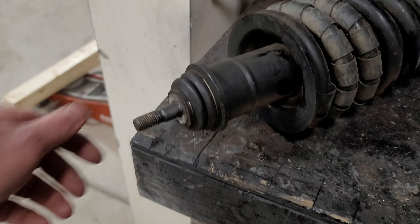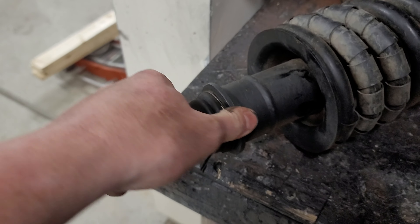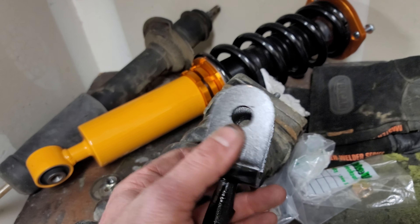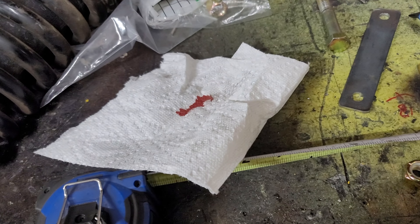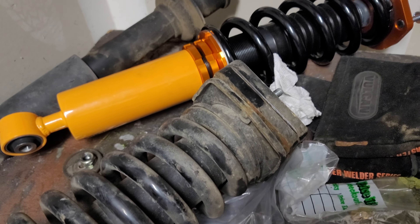Another different thing you can see with this is the factory one's got a ball joint — damn this thing is tight. I only put these struts in maybe two years ago when I first did the lift; I just said the hell with it and got some new struts. And this is the adapter thingabob. The ones that I ordered came with a bolt that was way too big, so I had to cut it out and weld in a half inch bolt — same as that guy, just shorter in length. It's taped up because I decided to just paint over it — it's whatever, no big damn deal.